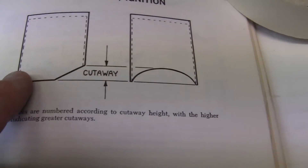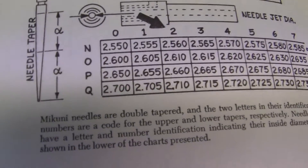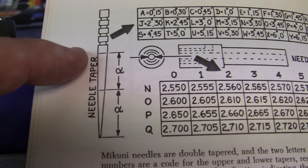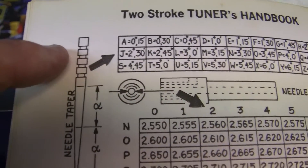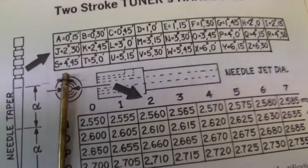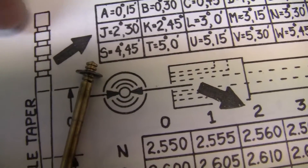Here are your different cutaways that you can have. Of course, remember this book was done in 1972. Right here, this is your needle taper. We see the needle jet right there. If I was to magnify that a lot, you would see that there are different tapers right here. On the new jets they have four tapers. You can also see right here one, two, three, four — that has four positions or three positions. I'll show you the pin — this is your little pin right here, or your little c-clamp. You'll notice there are five positions.